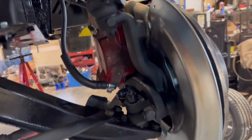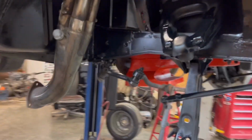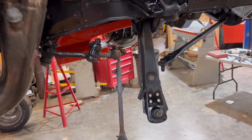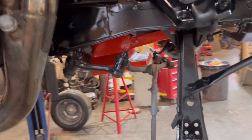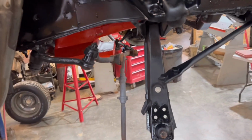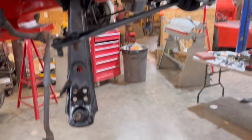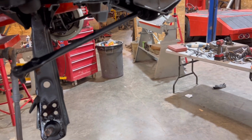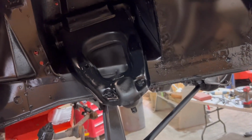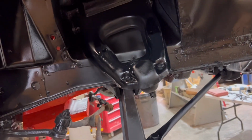It's all done. So now you saw me take this one here apart. It wasn't too bad second time around. Now I know what shortcuts I can take and whatnot. So I already put the new ball joints in, as you've seen. I just used an air hammer, knocked those original rivets out. It was just the easiest and quickest way. No messing around, so I can do other things yet today. So I am ready to start assembling this side. Sweet, sweet, sweet. Let's get going on that.